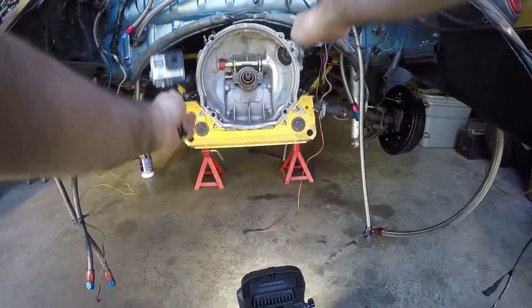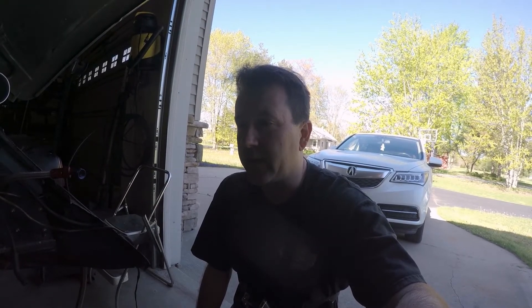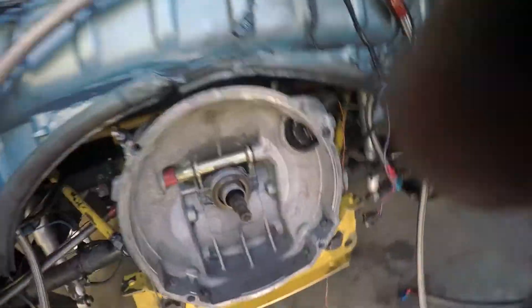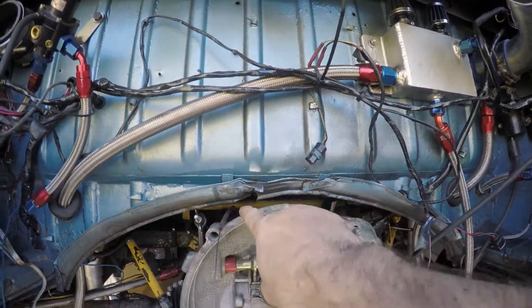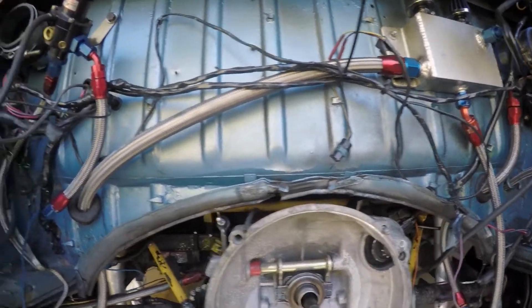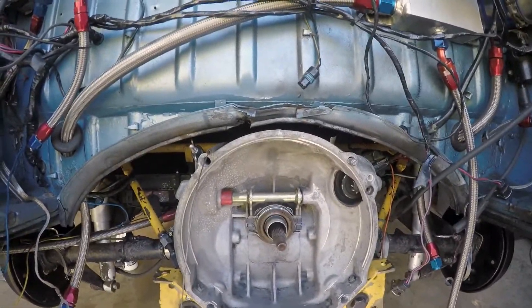There's the rear mount. The old turnbuckle goes down from the rear mount up to the crossbar which runs from shock tower to shock tower. The whole purpose of that is to keep the frame horns from flexing — that's what contributes to wheel hop and loss of traction. You want all this to be nice and solid.